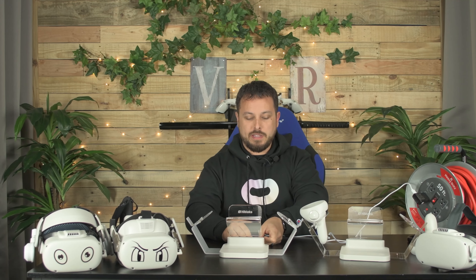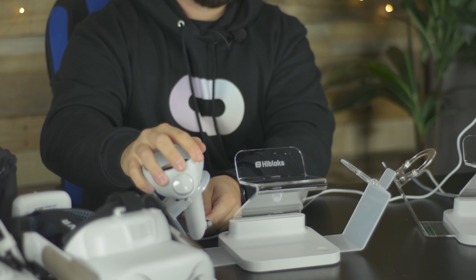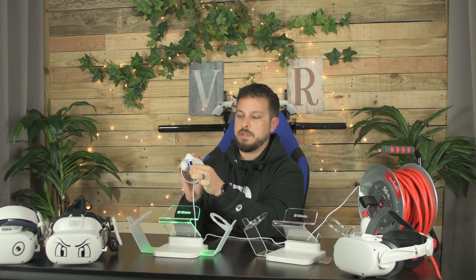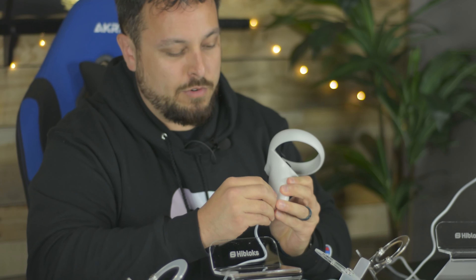So I said okay, let's find out. I'm going to exchange it for another one and see if that one has the same problem — using the same cable that came with the original one, same controller, same controller cable. Same issue. What I figured out since that original video: it's when it moves even slightly off-center that it does this, and it has to be perfectly centered. Something to do with the contacts crossing each other. It looks like these actually aren't meant for each other — this connector is very small and the socket is much larger, meaning there's quite a bit of play and it can move around.